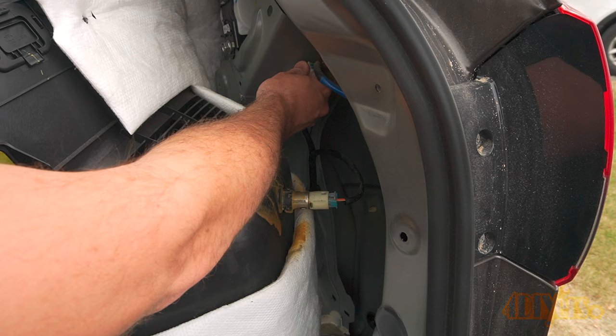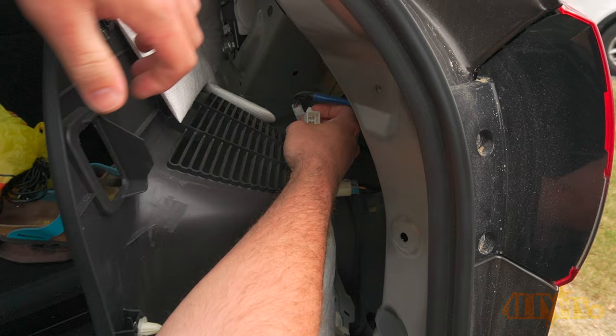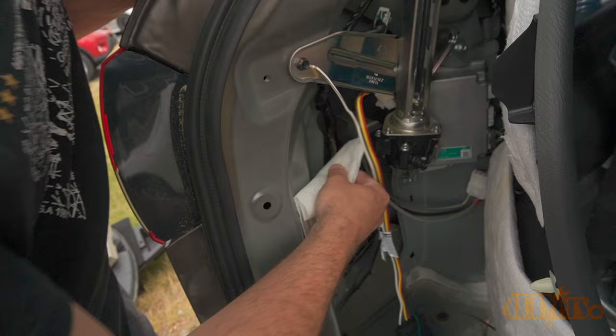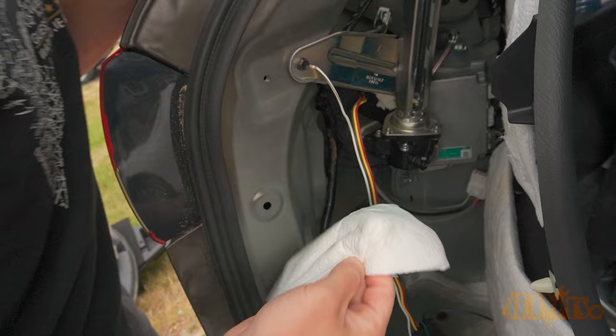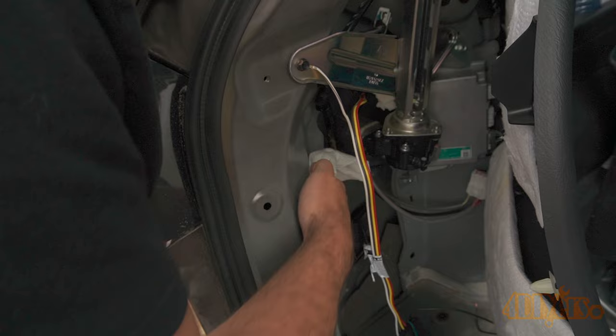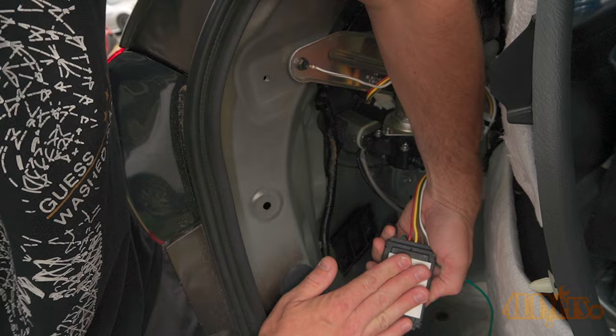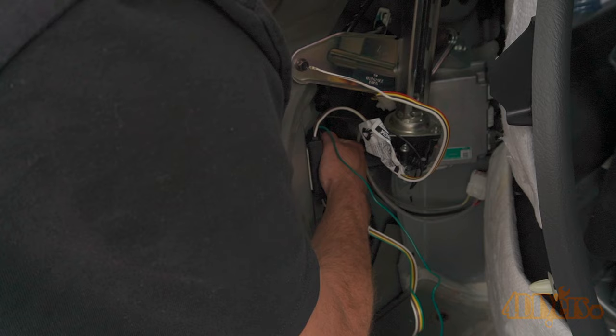On the opposite side I'm doing the same procedure with the light connector. Disconnect the existing connector and then plug in the trailer light wiring. Clip in the one connector to the retaining hole. The module will be mounted on a flat surface behind the trim panel using double-faced adhesive which is supplied with the kit. Using rubbing alcohol or window cleaner, remove any contamination on the surfaces for both the steel and behind the module box. Stick on the adhesive pad onto the module, then stick the module onto the flat surface firmly pressing it down.